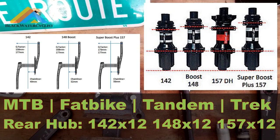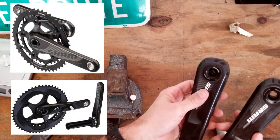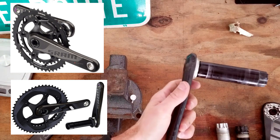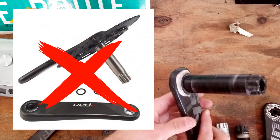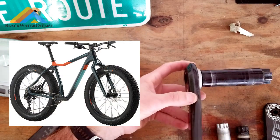The reason why I think this is an amazing modification is because you can really make a crank set fit any bike out there. You're going to want one of these SRAM crank sets — the S900, also the Force 22, and any SRAM crank that has a removable spider. It has to be the BB-30 or PressFit 30 spindle. You cannot do this with a GXP spindle.